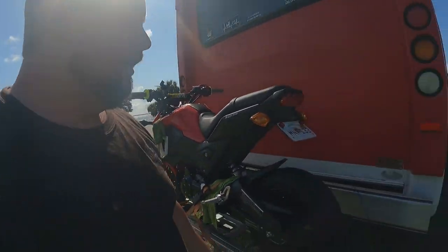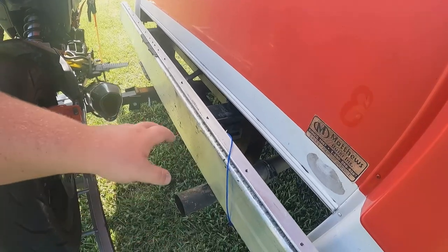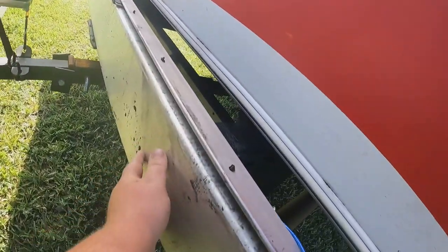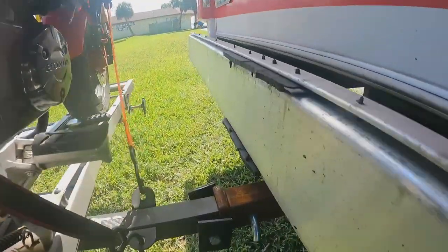Today I took the bus to the car wash this morning and scrubbed it as much as I could with a scrub brush, pressure washed it, and tried to get all the grime out — a lot of stuff came out. But there are still a couple things on here I'm going to try scraping with a razor blade to get the rest off. Then I'll wipe it down one more time, run to the store, get some paint. I'm also going to sand down this hitch and spray it with a rust coating so it doesn't look so rusty — it's raw steel, so it started to rust up as soon as the water hit it, but it's just surface rust and I want to keep it that way.